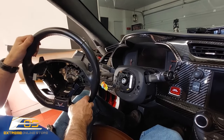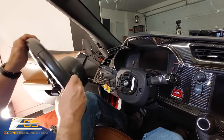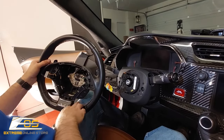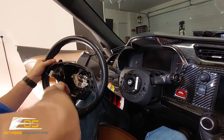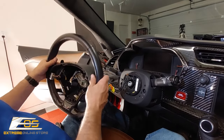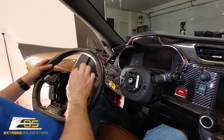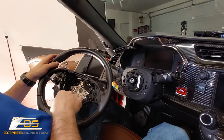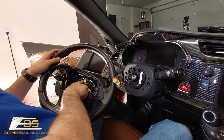All we have to do, we're going to go back to the bench now, and we're going to take our steering wheel over there, and we're going to take the paddle shifters off and transfer them from this steering wheel over, also the speaker controls, as well as your channel selectors over here, and the paddle shifters, will transfer those onto the new steering wheel. Okay. And then at that point, we're also going to be tying into our wire harness. So we'll be pulling this wire harness out of the steering wheel, transferring it in, and we'll be tying our power for our steering wheel into our harness here.